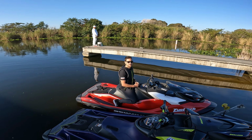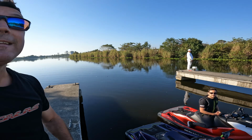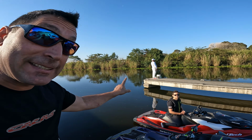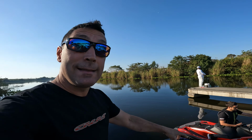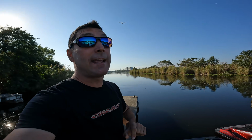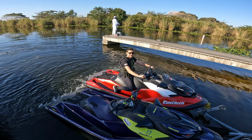Yeah. Now, what you guys gotta remember is this ski is completely stock. There's no air, nothing drilled for air. It's got a stock intake on. Completely stock except for the fuel tank and the Calas Cam with the springs and retainers. That's it. And right after this, we're gonna drill for air and put an intake on. We're just gonna keep going with the same cam-only setup and see how far we can take it. All right, here we go.